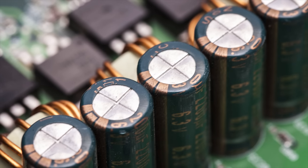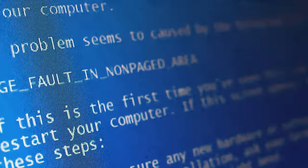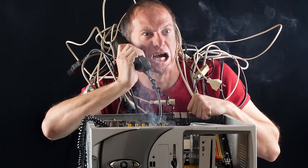As well as capacitors, which both serve as temporary storage for electricity and protect against sudden voltage spikes. Now, admittedly, these things aren't as exciting as putting in a new $400 graphics card or whatever, but the quality of your VRMs can make a huge difference for your PC. For starters, cheaply made VRMs can lead to system instability and crashes, even at stock speed. And very poor quality VRMs can even mess up the power delivery to the point where they'll damage your other expensive components. And if you're overclocking, you won't get very far with a poorly engineered VRM, since correct voltages are so important to system stability when pushing your components beyond their rated speeds.